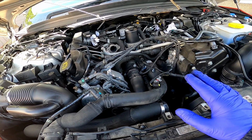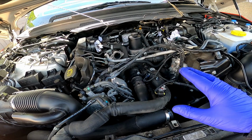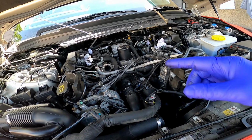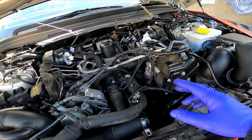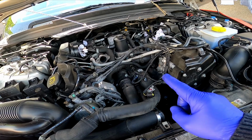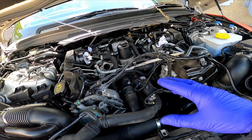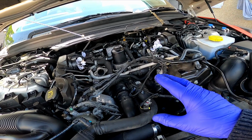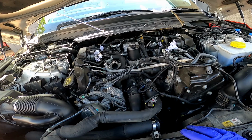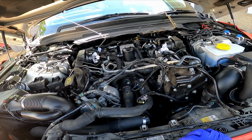Next thing we're going to do when we put this back together again, we will take it for a run, and probably lots of smoke coming out the back of it. We've already recorded the mass airflow pressures and temperatures on our gap tool, so we'll take it for a run again, have a look at the numbers to see if there's much of a difference, which I don't think there is. Then once we've done that, we're going to use an inlet injection atomizer to try and get some of the carbon out of the inlets. We'll then carry out an oil change for the deposits of carbon that's got into the oil, then we'll test the performance of the car again, and we'll put the gap tool on it, take it for a run to see if there's any difference in the mass airflow, temperature and pressure sensors. But meanwhile, we shall now try and rebuild the inlet and put it all back together again and see how that goes.